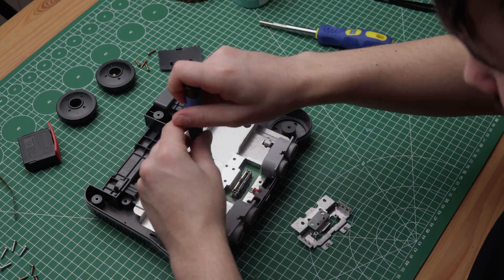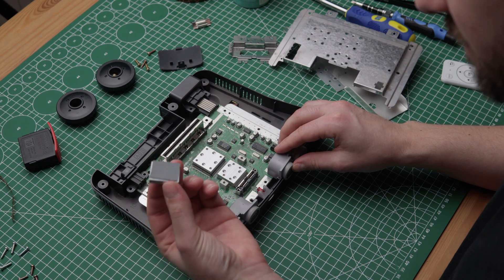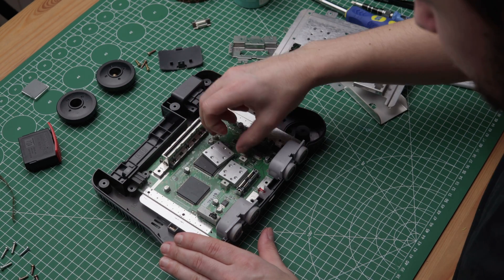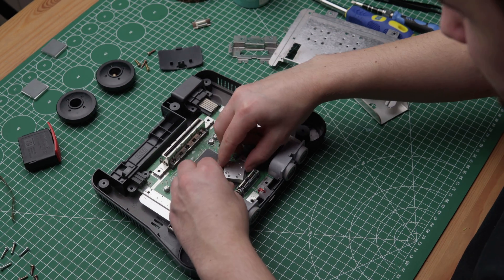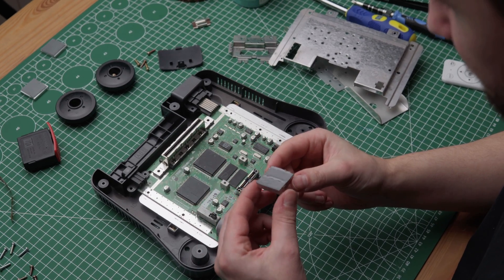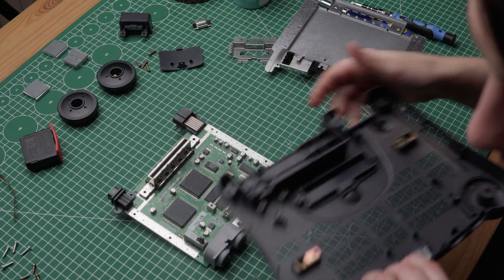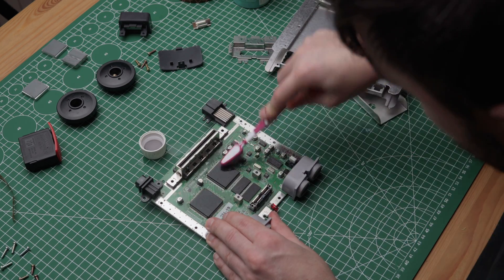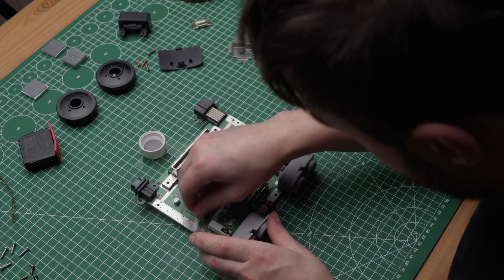With that, the whole metal housing should come out easily. There are some heatsinks on the chips which we gently remove to expose the one we need — the RCP NUS, which stands for Reality Co-Processor. The suffix NUS stands for Nintendo Ultra 64, the console's project name while in development. I give everything a good clean before we start soldering because I haven't been in here for years.